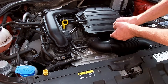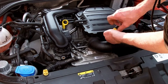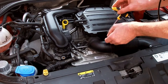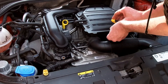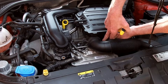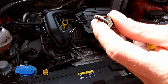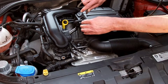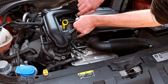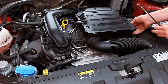To gain access to the plugs and the coil packs, use a T30 screwdriver and remove the retaining screw for the air filter housing, which is situated in the middle of the housing just at the foot of the engine. Then remove the two pipes either side of the air cleaner. If it's been on for a while, it can be easy to prise it off with a flat bladed screwdriver.